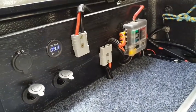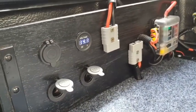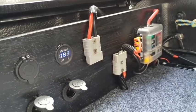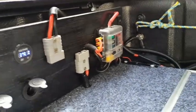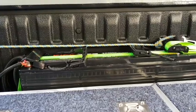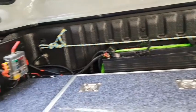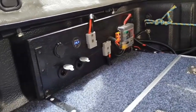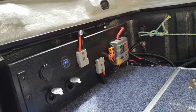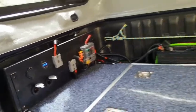We're done in here - car's running, just wanted to test everything out, make sure it's charging. You've got all the accessories here - volt meter's saying 14.1 volts. The car's giving the battery good charge via the Projecta charger. That's the 170 amp hour Kick-Ass slimline AGM - fits really nicely in there, just got to cover it up a bit once I tidy everything up. It's just a homemade panel there, little fuse box. I've got the Anderson plug, solar input which goes into the charger for unregulated solar.